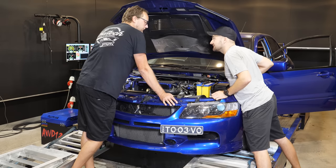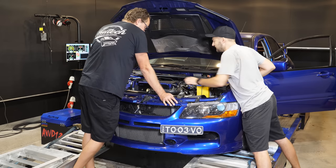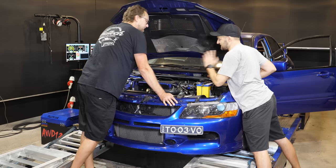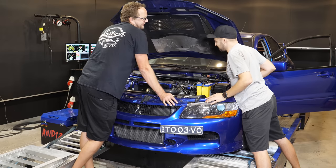I think it's just time to get in there and have a go. Exhaust manifold and all of this looks beautiful and not leaky and seems to be working. I'm hearing a bit of ticking, but it comes and goes, which is interesting because it didn't come and go before. It was just ticking all the time, and now it'll stop for half an hour and then it comes back. So I wonder with oil temp and after we give it a bit of a boot full, see what happens. Just see what it does.